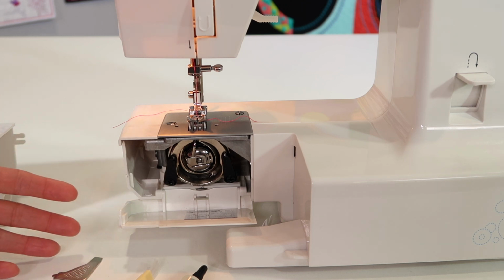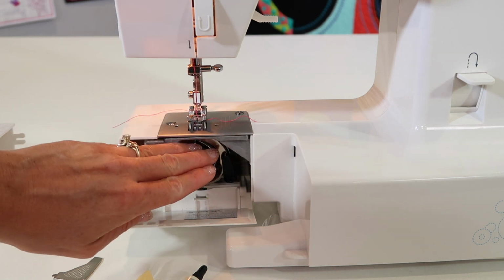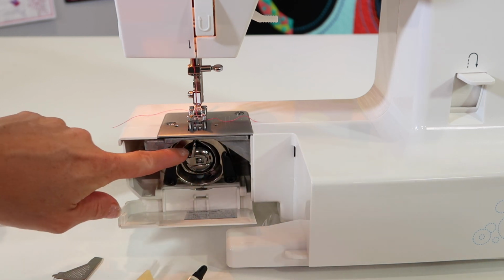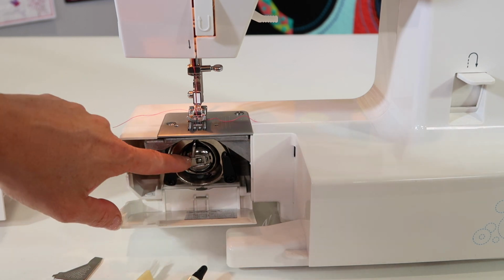And why are we needing to do this in the first place? Well, sewing is a very linty activity. When you start using fabrics like flannels and fleeces, even batting can all create this nest of fluff down in this area. Of course, once it starts to continue to grow, it absorbs the oil away from the metal moving parts. So I usually recommend our students to do this every 2 to 5 bobbins.